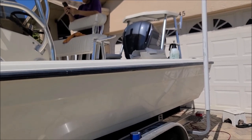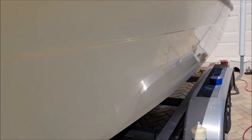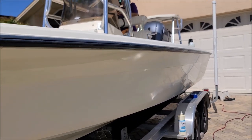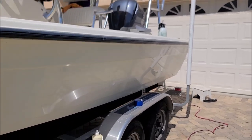The unsanded part doesn't look bad at all, so I'm going to keep on keeping on. But I wanted to show you guys the difference between sanded and unsanded. You can see in here where it's all spotty and patchy — over here that's all gone. This is just deep, deep oxidation in the gel coat that has to be sanded off. When you sand into oxidation and remove it, cutting into the gel coat and refinishing, your details last a lot longer. It's a lot more work, which is why a lot of guys don't do it, but I always show everyone the difference.